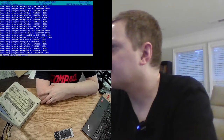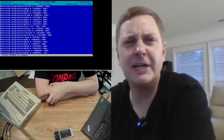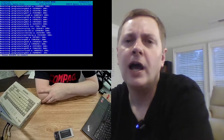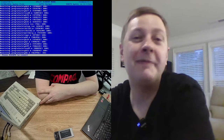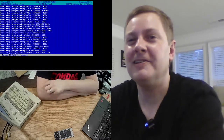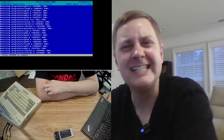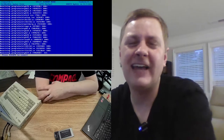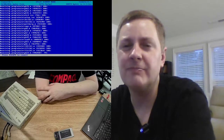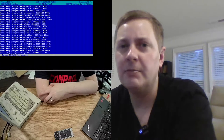So Geek with Social Skills says, a 286 running at 16 bits, with the built-in Tandy graphics and sound, the built-in drive controller, et cetera, it's fine that the slots are only 8-bit. Oh, okay, not too huge of an issue. Yeah, that's a good point, because what would you really want 16-bit for? Maybe adding video, but you're using Tandy video. I may get in trouble for saying this as well. I have my opinions, but I know there are folks that have taken their Tandy 1000s and added VGA graphics to it. I have other machines for that. For the 1000, I kind of like keeping that stock CGA or Tandy graphics on a CGA monitor. Sure, VGA is going to be crisper and clearer, but I like having that.